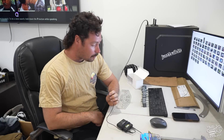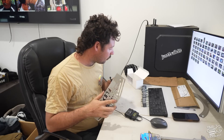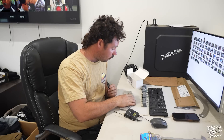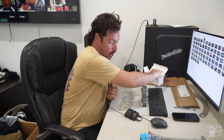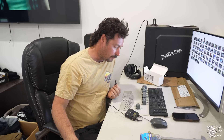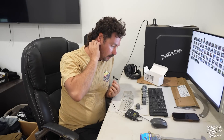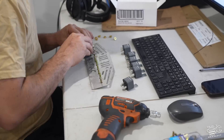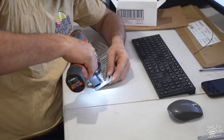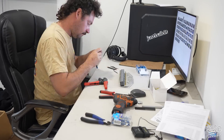I just ran upstairs because it's absolutely boiling hot today - sweating in the shed. This plate came out pretty nice. With this relay panel I've gone and put 10 relays on here. I don't need 10 immediately but the biggest thing with wiring this whole car is making sure I don't have to add things later that I haven't accounted for. I'm going to wire it up first, do a bit of a time lapse, then run you through how I've done that and why. By doing it standalone and then hooking it in later it's really good because you can work on it outside of the car and in the air con.